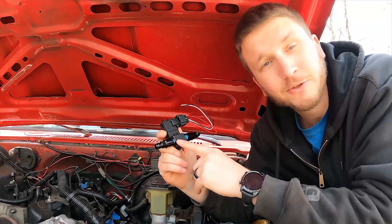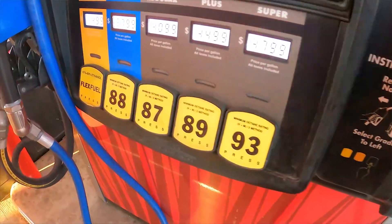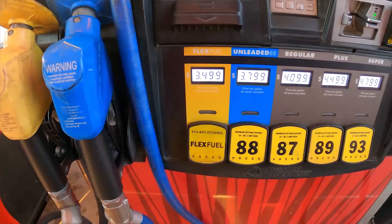If you don't remember what I did in one of the previous videos, linked in the description below, I added an ethanol sensor and tuned my vehicle to allow for flex fuel. What the flex fuel conversion does for me is it allows me to utilize an ethanol fuel from anywhere from 0% to 100%. Standard gasoline from the pump comes out at about 10%. E85 comes out anywhere from 51% to 83% at the pump. So utilizing the sensor that I installed, I can dictate to the computer how much fuel it needs to use.